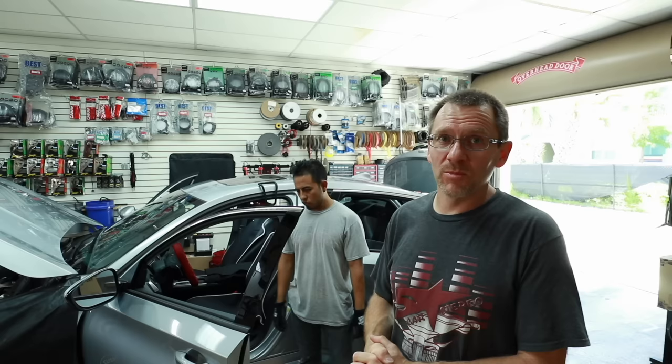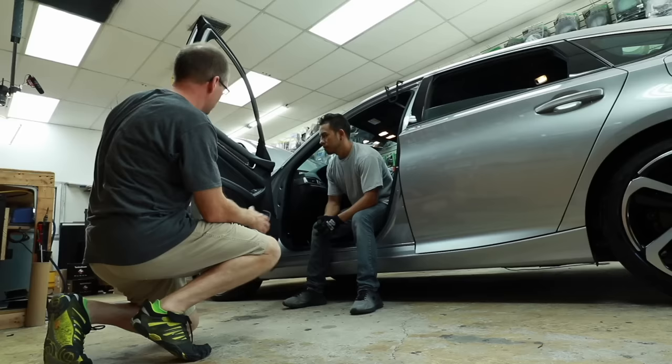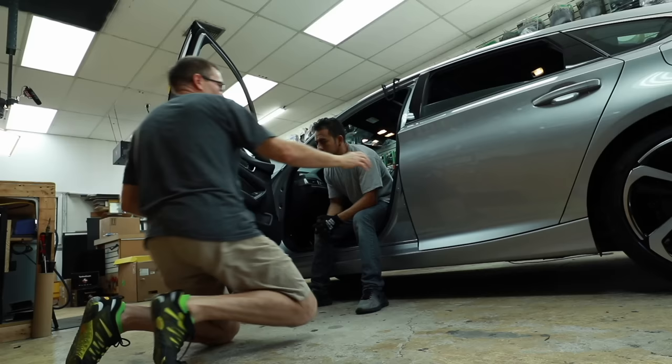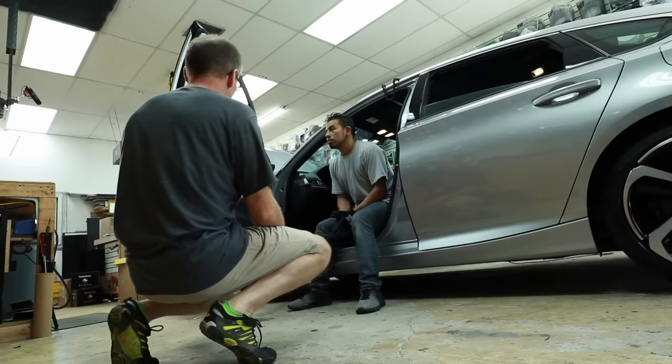One of the things we do right when a car comes in, along with all the testing, is spend a couple of minutes going over the criteria of the car. We need to go over with my partner Fernando what he's going to be responsible for and what I'm going to be responsible for. He's going to start on the sound treatment. We're going to do our premium treatment package — make sure we cover all the joints on the door panel, focus on the speaker area, and get the whole inside skin of the door panel as much as possible. We're not doing the back doors because there are no speakers in there, but we are doing the rear deck. We're putting the Tempo Ultras in here with fast rings.